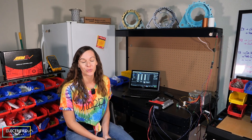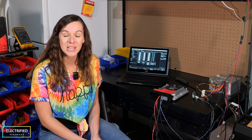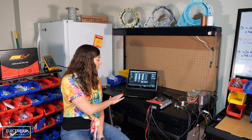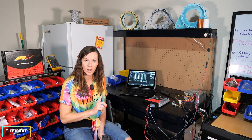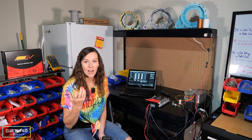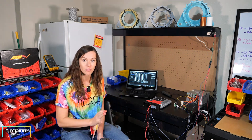I hope this video was useful for you. It took me quite a long time to get familiar with these things. I'm not an expert in CAN communication, but I hope I could give you a first overview of what we are planning to do with our electric Jeep. I'll cover all the details of how we're actually setting up all those CAN lines in future videos. Our approach is first to hook up the VCU with the calibration software and get familiar with it — check. Then connect the VCU with one BMS master module already attached to the battery module, investigate the cell voltages, try out charging, see how cell balancing works, and get familiar with the BMS. Over time we'll include more and more components, staying in a test bed environment as long as we can to make sure everything is connected correctly before testing in the real Jeep.